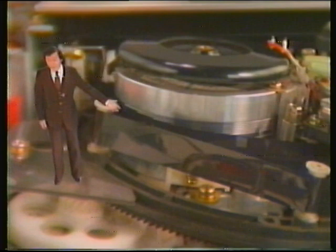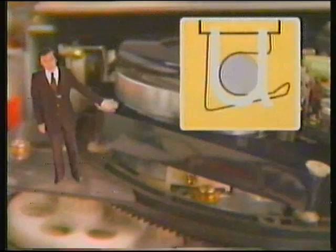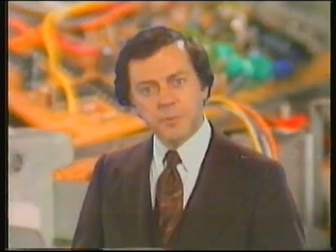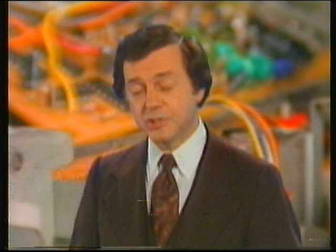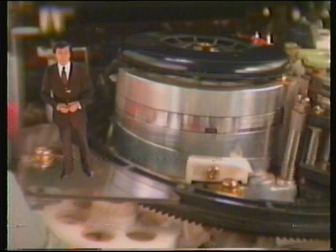The second reason is the U-loading system of the Betamax. It's used to load and transport the tape. You know, Sony developed and patented virtually every system of tape loading and transport in general use today. Even the systems used in other machines were invented by Sony. We decided on U-loading because it offers the highest reliability. Its gentle tape handling characteristics make picture search possible.